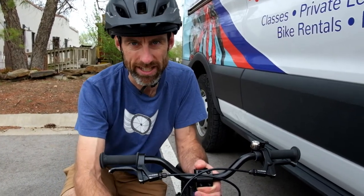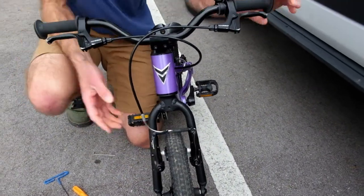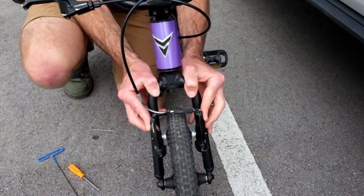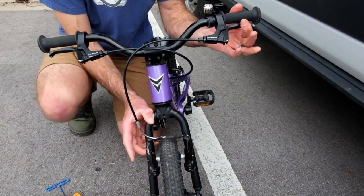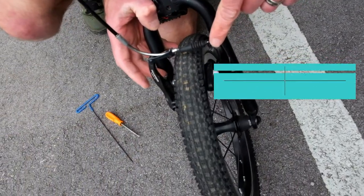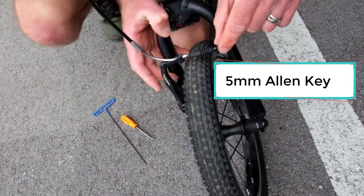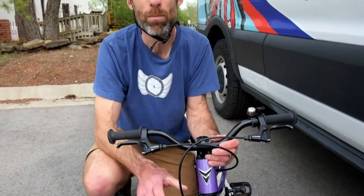Once you adjust these brake levers for reach, it might actually restrict the brake on the rim to the point where you can't turn your tire. What you've essentially done is moved the brake arms closer to the rim by moving the brake in towards the handlebars. If that's the case and you feel comfortable, you could loosen the pinch bolt on your brake with a 5mm Allen key, relax the cable a little bit, and retighten the pinch bolt. If you don't feel comfortable with that, please take your bike to your local bike shop. They will help you out — super quick, super easy — and make sure it's done properly and safely so the brake doesn't come undone later on.